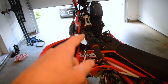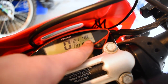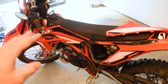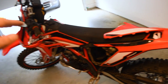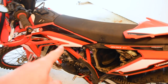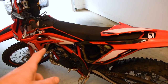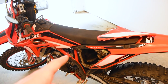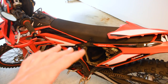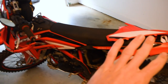The only thing that does suck is if you leave it with the check engine light, you won't be able to see any of your statistics — your odometer or any information in the bottom right corner of the screen; it's just going to say 'check' with the check engine light illuminated. This is why I've left my bike in stage one — it's easily reversible. If I ever want to start using oil injection again, I just cut that one zip tie off the intake, plug the oil injection back in, and the system should work. It's also useful if you were stuck somewhere and needed to run plain gas from another bike, or if you needed to pass a vehicle safety inspection with everything functioning OEM.